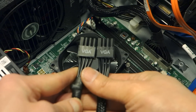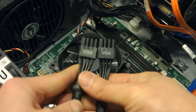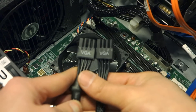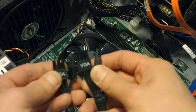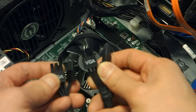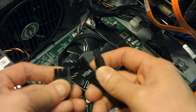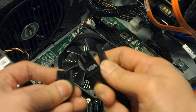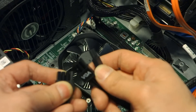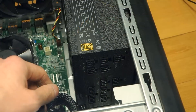Last but not least, you'll want two of these VGA cables - it really depends on your setup. The HD 6970 requires one 6-pin and one 8-pin, so depending on your GPU, set aside one or two of these cables. The labeled side goes into the back of the PSU; the other side splits into a 6-pin/8-pin combo. The 8-pin supplies 150 watts and the 6-pin supplies 75 watts, for a total of 225 watts.